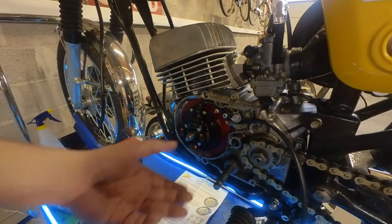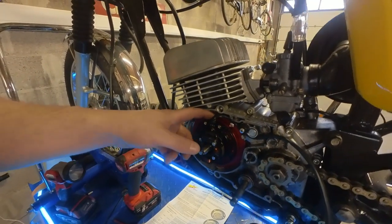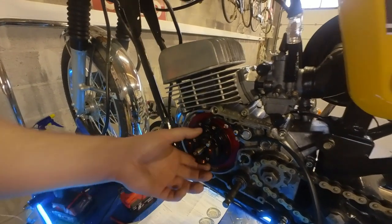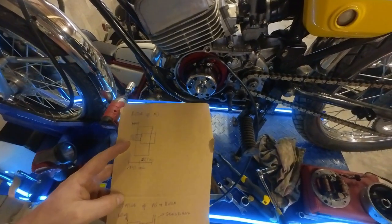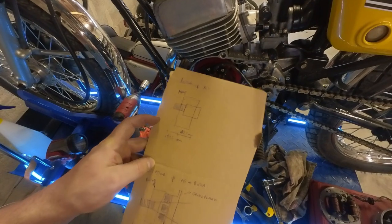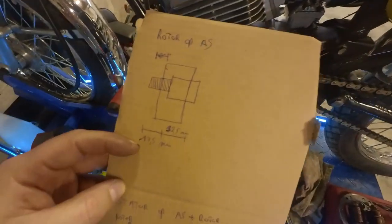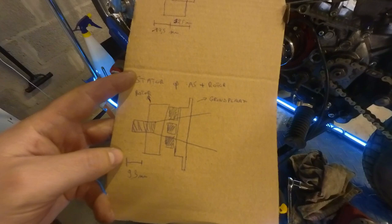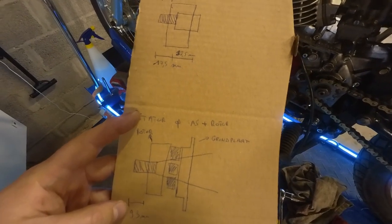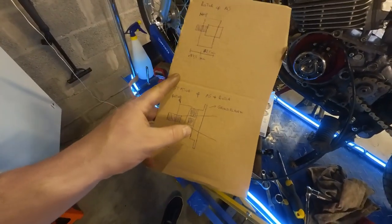So I'm going to do a test - just to test fit the rotor. I'm going to take this off and just fit the rotor as is, see if that fits. Maybe we have to work something out with a slimmer base plate, which is pretty strange because this thing should be for an RD-50. So I've done some measuring. If I put the rotor onto the crankshaft without the stator and base plate, the threaded part sticks out 17.5 millimeters to the surface where the nut has to get onto. But with the stator assembly we only have 9.3 millimeters. That seems like a lot of difference, so if I tighten the nut the rotor just jams itself onto the base plate and the engine is stuck.